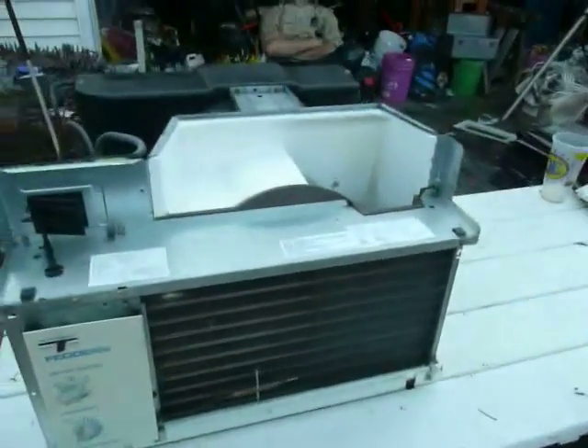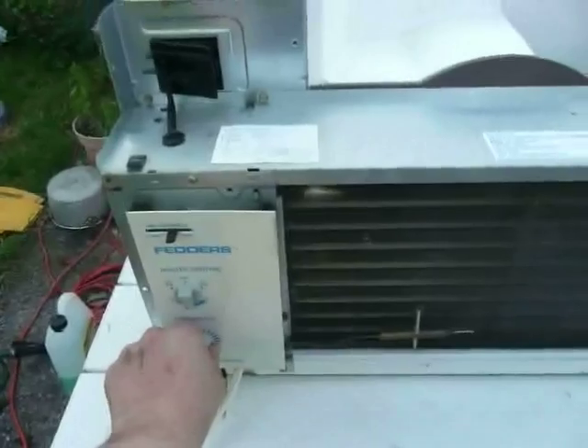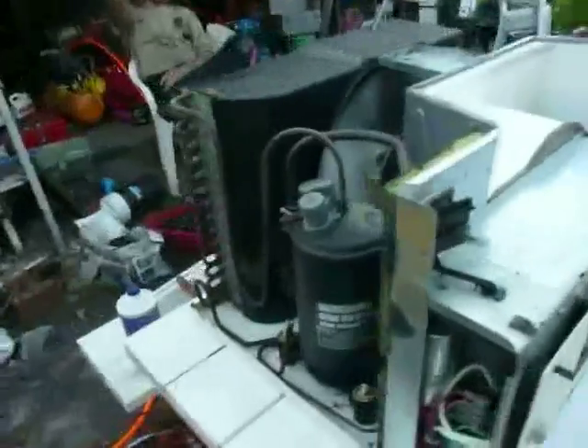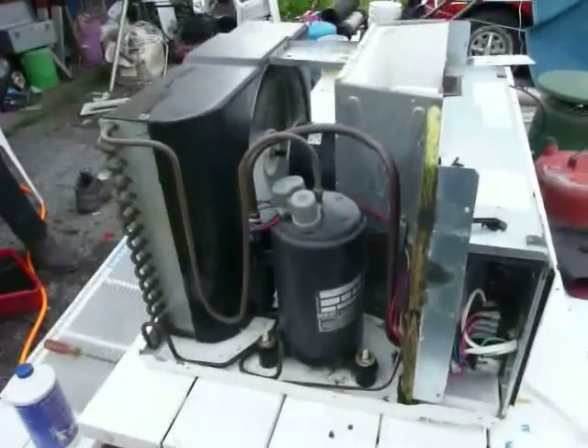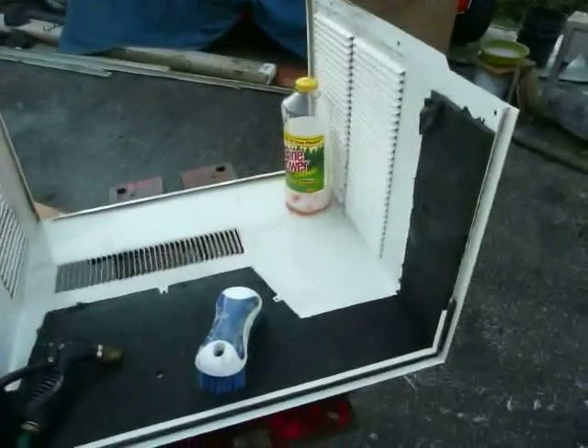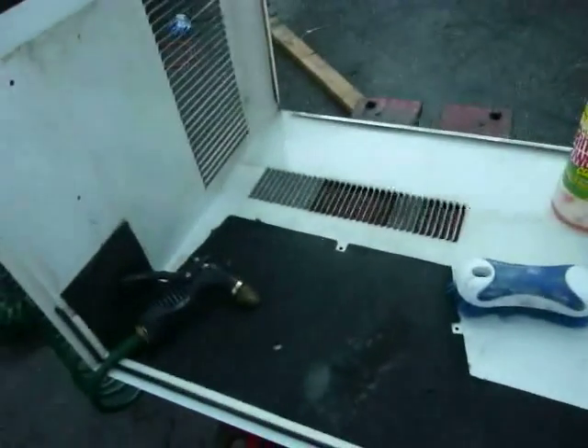Once you've gotten your air conditioner all cleaned out — and you can see it does look tremendously better inside and out — it's time to give it a little bit of a run-up. It won't be running at its most optimal at first. Run it with the fan a little bit to make sure it dries itself out reasonably well, and make sure you've got airflow through the coils. Make sure you're using a heavy enough cord to handle this, because most air conditioners can pull fairly hard. Switch to the cool mode and turn it on. Listen to your compressor — the sounds it makes indicate how healthy it is. Your compressor should just make a smooth, even running noise. Anything that sounds harshly metallic is an indication of trouble. And definitely don't forget to clean out the inner shell as well, because dust and dirt can build up in there and will really kill your efficiency.